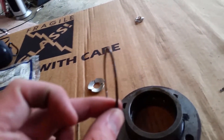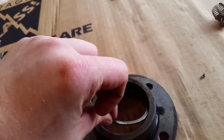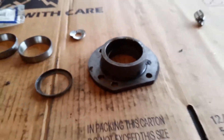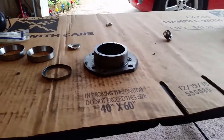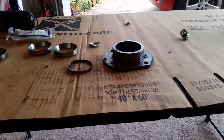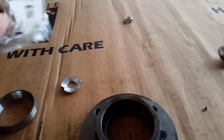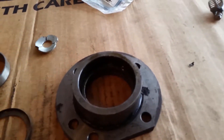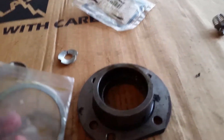As you can see, this is the original shim that came from the factory for the old differential, and we're going to leave this sitting right in there. From what I've read on the forums, you want to add shims to the driver's side of the transaxle only — I could be wrong, but all I need to know is that I need to get my end play within spec. I'm going to take my six shims, stack them on top of the existing shim, press in the new race, bolt it all back together, and remeasure.